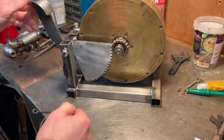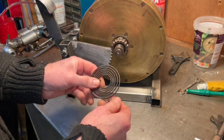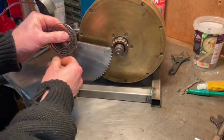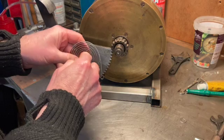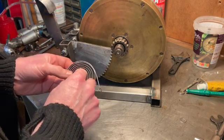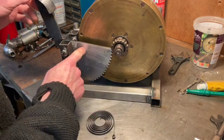I lied - I'm not doing ignition timing next. I'm going to do the return spring because this has just turned up in the post. It's a kickstart return spring off some old British bike - Norton or something. It's basically like a watch clock spring. That's going to go in there somehow. I have a plan: make a spacer that goes in there with a slot in it, then wrap the spring around and hook it over a pin that comes out. So first I've got to make a spacer the correct width with a slot.